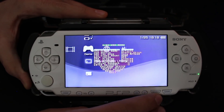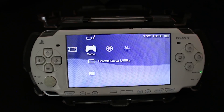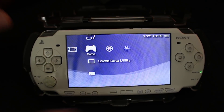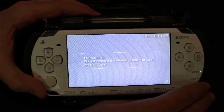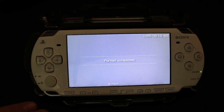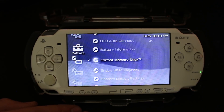To test that this is working, press Select, go down to Shut Down, and press X. Turn on your PSP — it should boot into custom firmware immediately. Once it boots up, press Select and if the VSH menu comes up, congratulations — you now have Infinity successfully installed with a cold-booting custom firmware, either LME or PRO. One final recommendation before copying over any data: go to System Settings > Format Memory Stick, say yes to both prompts. This removes the setup files and creates custom firmware-specific folders.